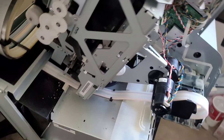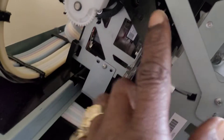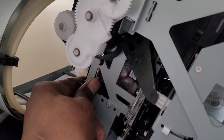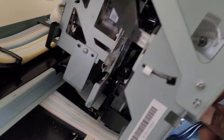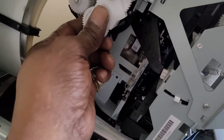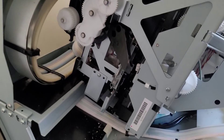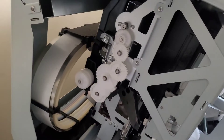Since I can't power the printer on, I can't remove the print head normally. So what I did was take the whole right side off the ink cab and the ink assembly. There's a piece in here that locks the print head in place — FYI, if you ever have this problem, just push this piece down and it will slowly move out of the way so you can free up your print head. Now the print head is freed up and I can go in the front and remove it from the ink selector assembly.